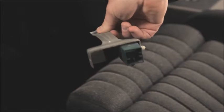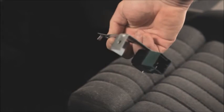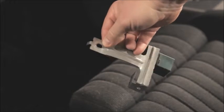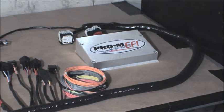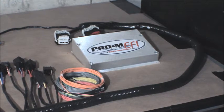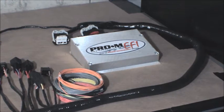If you are using it in a 91 car, the fuel pump relay under the driver's seat is no longer used. You can remove it if you'd like, but that's not necessary. It's important to note that no other wiring changes are needed to use this harness in a 1991 car. The changes are incorporated into the new harness. Just plug it in and the conversion is complete.